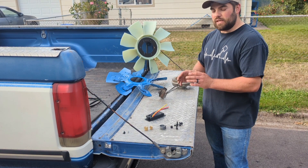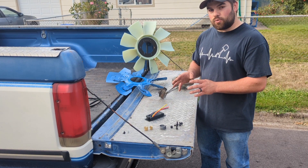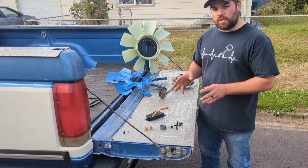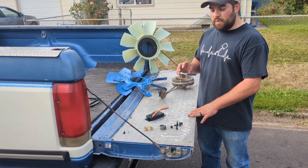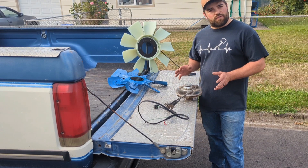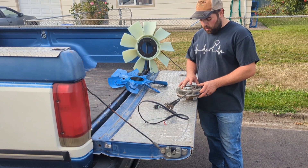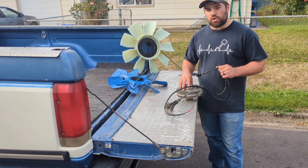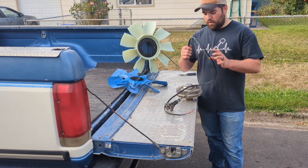This gives the driver the ability to just drive and not worry about how much the fan is cooling, because the controller takes care of it. It also has a wonderful feature of mimicking the factory PCM output of a 6.4 Power Stroke almost exactly. I tested over a dozen different fan controllers until I found this one that mimicked almost exactly the factory hertz frequency the PCM puts out to control the fan clutch — I chose that because I want this fan clutch to live as long as one in a 6.4 Power Stroke would. I also use Motorcraft in the fan clutch for the same reason I use Motorcraft in the connector: their quality control is better than aftermarket, which results in better cooling overall.